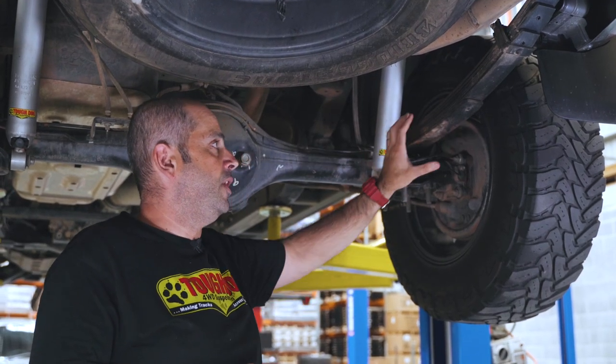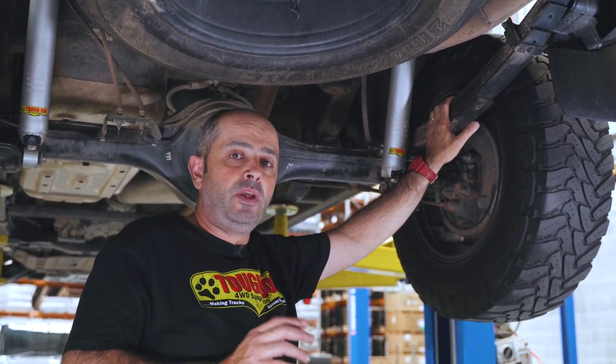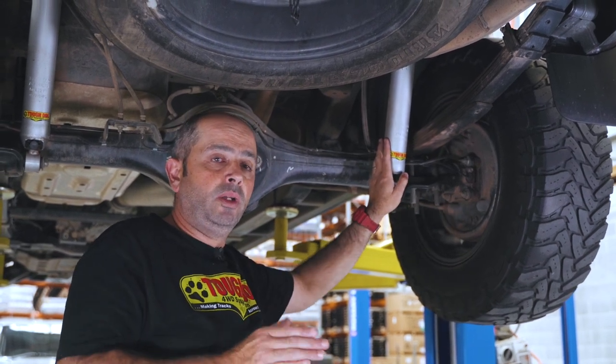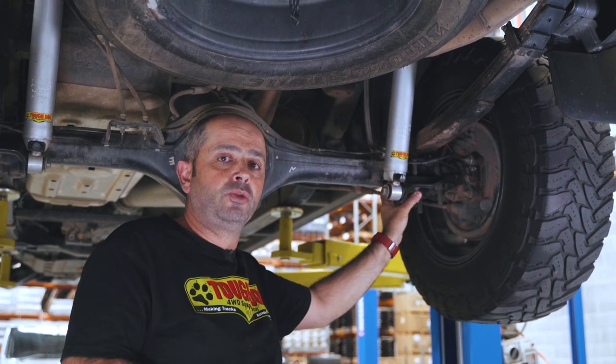The reasoning for this is there is a bedding process in the leaf spring between the friction pad and layers of paint within the leaf spring itself. After the 500km, the U-bolts will have run themselves a tad loose from the original torque setting.